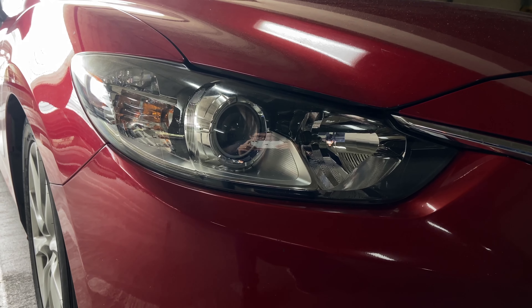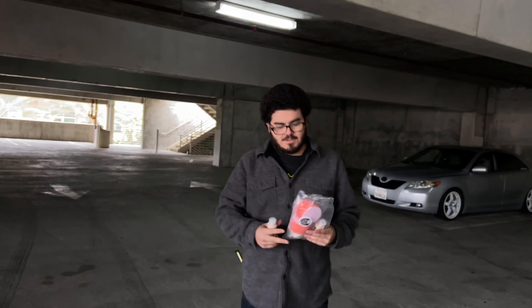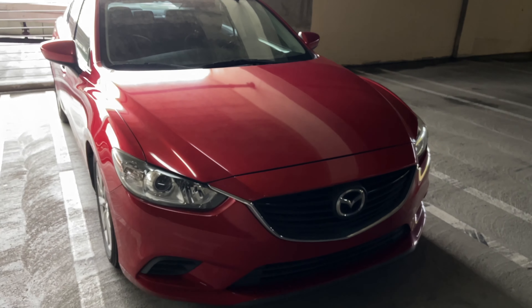The headlight clearing is done — it only took about 25 to 30 minutes. If your headlights are just slightly foggy, we used the Headlight Sauce product — it's ten dollars a bottle. You use three drops on your applicator pad, tape off the surface, and polish it off with a regular power drill. That clears off all the oxidation. The last step uses a different product from Meguiar's, which you put on the light to keep it from getting yellow. The kit is twenty dollars. Follow me on BreakNerd on Instagram and I'll get you set up with your own sauce kit. Hope you enjoyed the video — I'll see you in the next upload.